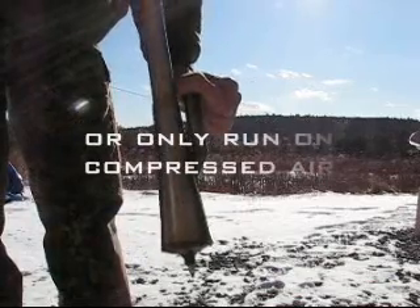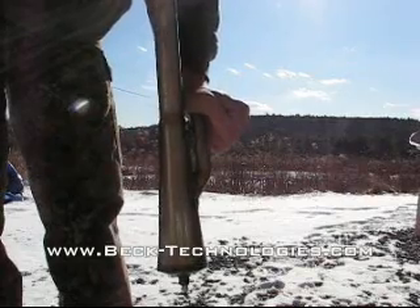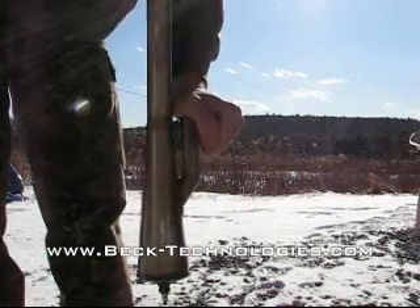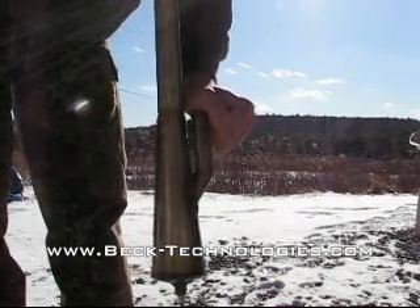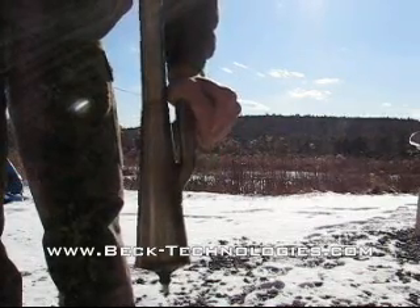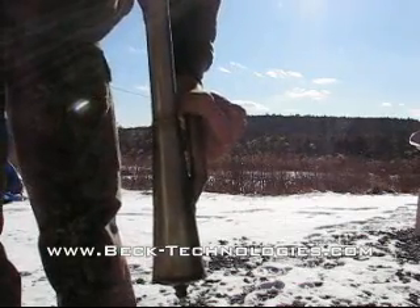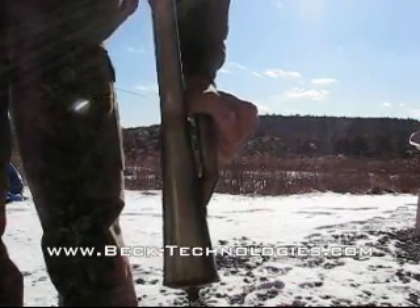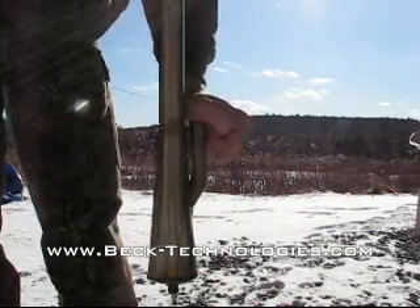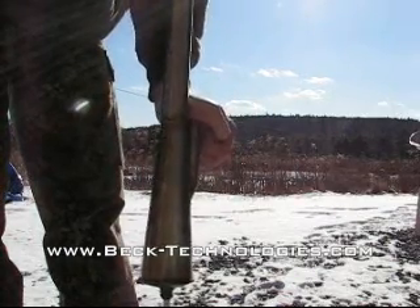This is just a leak test to make sure all the welds are totally leak-free. We'll do this with all the engines. A little engine like this can run with a few little leaks, but the more leaks there are, the less it will run well, and the throttle will be a lot worse. If you're ever going to run it on liquid fuel, you absolutely need it to be leak-free. The little spot-welded engines that are flooded on eBay these days are definitely not very good.